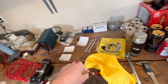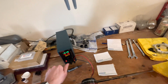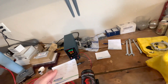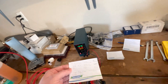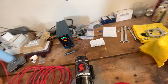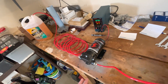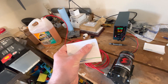So this is the setup I've already shown you. I place the nozzle in the measuring glass, set a timer for one minute, activate the pump, stop at one minute, and get the flow rating. I'm testing the number four, number six, and number 12 nozzles. The number 12 I bought separately — the kit comes with number four and number six — but I wanted to test it. That's true for both the nylon line and stainless line versions of the V2 stage one kit.